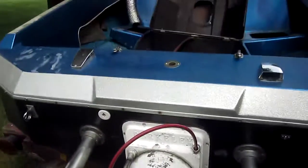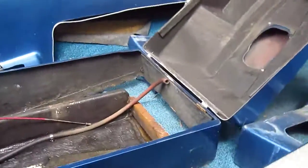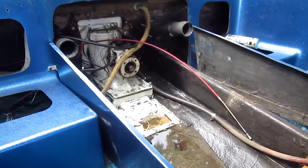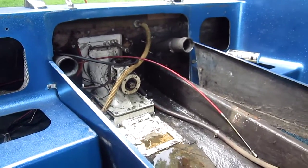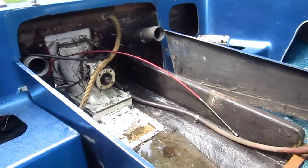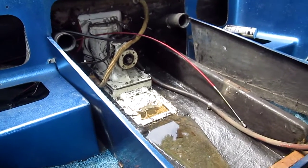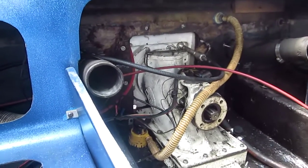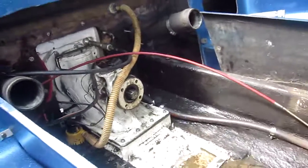As far as why we have to get the wood out — fiberglass boats are basically just a shell of fiberglass with a whole bunch of wood glued to it. The wood gives it its rigidity and structural integrity, and it's what things bolt to. So if it's rotten, you've got to get it out. Once moisture gets into the wood it starts wicking through like a cancer and it has to be rectified. I hope that's helpful — thanks.